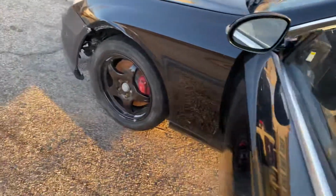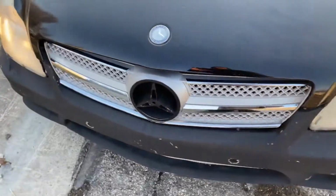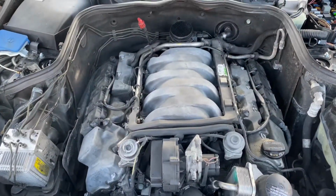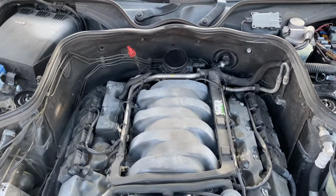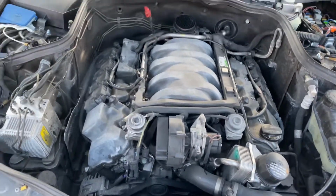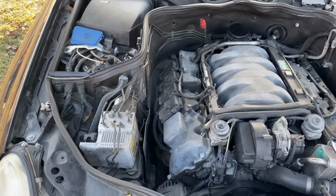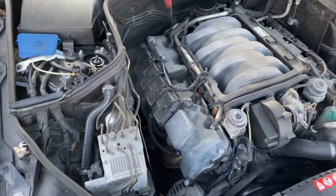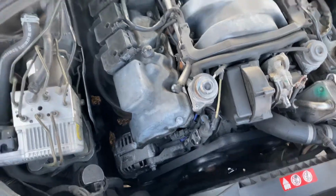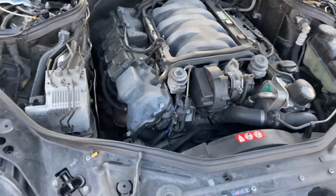Now, there is some knocking going on. Listen to it. That don't sound good. Definitely a misfire. It's a whole lot of popping and knocking going on up in here. See, obviously some gas, some oil is burning off. Look at all this knocking around. That ain't good. Sometimes you don't know what you got until you get it running. You realize there's some other issues besides fuel.